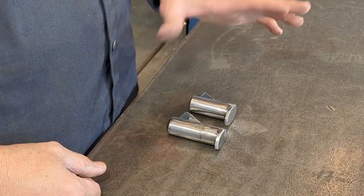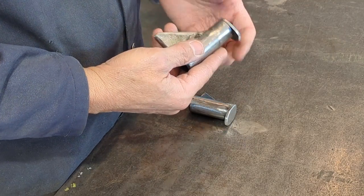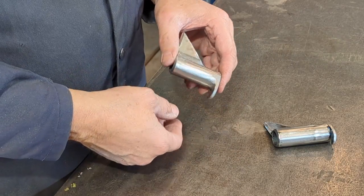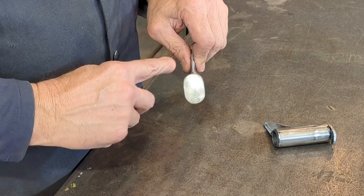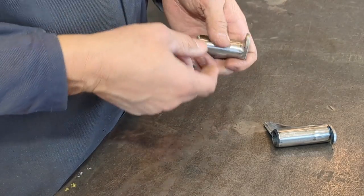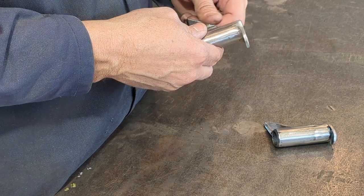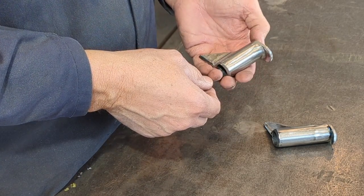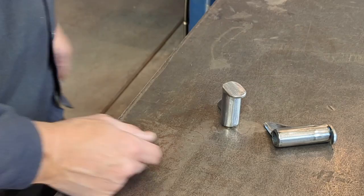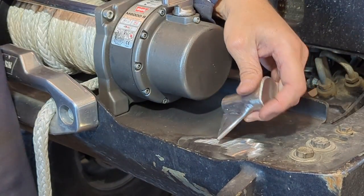After a little bit of welding we have our final product. This was the original prototype I slapped together; I took some height off the deck and you can profile it however you want. I made sure to smooth all my edges because I don't want to tear up the thimble — no sharp edges. If I'm using a soft shackle I don't want anything creating issues. So this is the final product; we'll put it on the bumper and weld it in. I have my bumper cleaned up and ready to go.